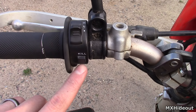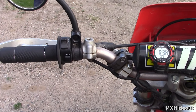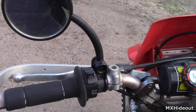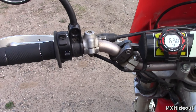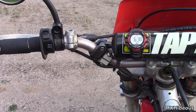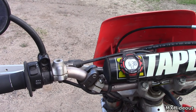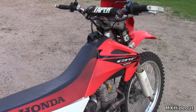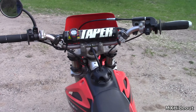Every bike has a kill switch, and it's not very often that this happens, but if you get in a crash or if you live in a high humidity climate, it could get corroded. The wiring and the kill switch could be broken on the inside, causing the bike to think that you're holding the kill switch — so it's not allowing power to start the bike. If you have a similar bike, you can try swapping out the kill switch and seeing if that is the problem.